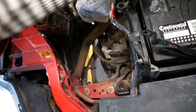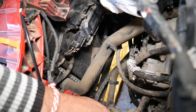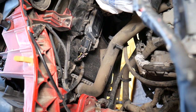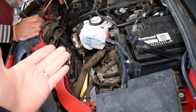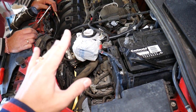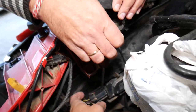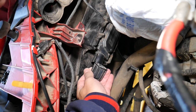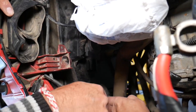The air filter box is out of the way, giving us more room to the radiator fan and radiators. Make sure to disconnect your car battery because the radiator fan is right there — if your fingers get caught and it turns on, it can cut off your fingers or hand. We already disconnected ours. Now we need to disconnect the wire on the fan: press in and pull out. Then use a clip removal tool to pop the cable clip loose off the radiator fan.